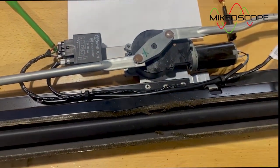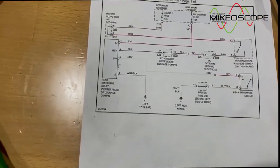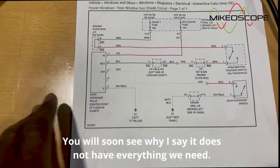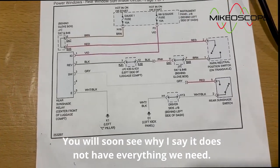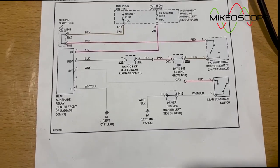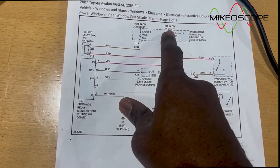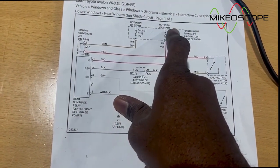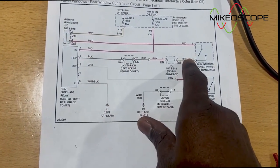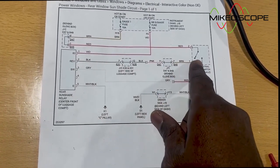Guys, so in order to understand how to bench test this assembly, we need to understand how this wiring diagram works. So unfortunately, the wiring diagram doesn't actually have all the information we need, so we need to go back to the back of the car where the entire assembly was and figure out how the wiring is, because if you look at this purple wire here, it should be hot in on or start. And then this wire here, we need to understand, is this closed when it's in reverse, or is it open